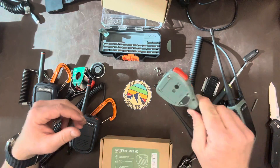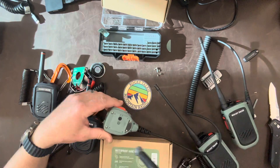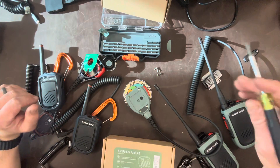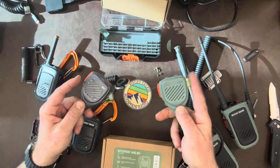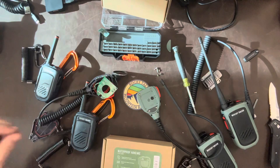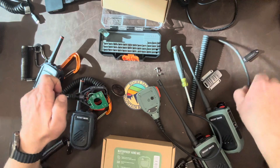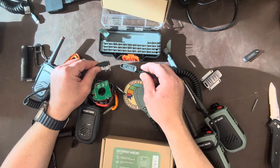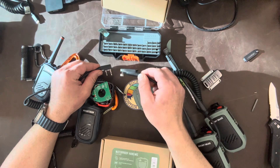In the last video that you will never get to see because it apparently didn't get recorded, I took it apart and compared it to the original Rocky Talkie remote speaker mic. The early question you may be asking is: can I use the Mountain radio speaker mic on the GMRS? And the quick answer is no, you cannot. They are different, and the biggest difference is in how they connect to the radio. One has a Kenwood-style two-pin connector, and the other has what they are calling a Motorola M3-style surface mount connector.